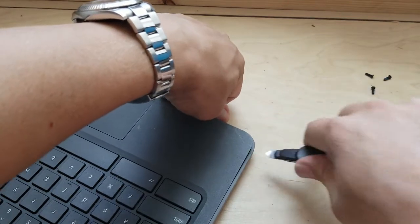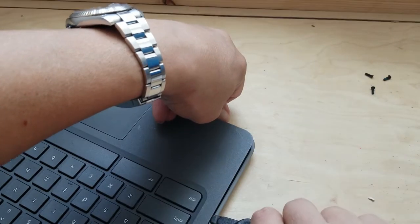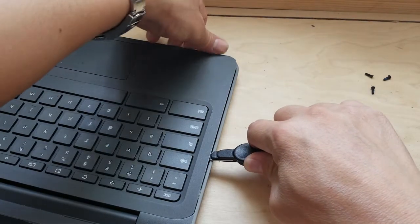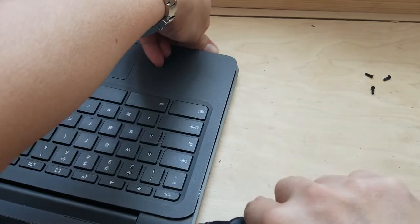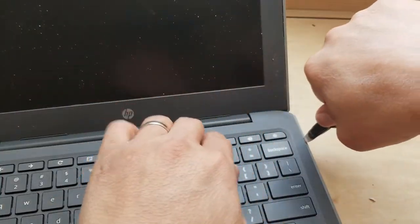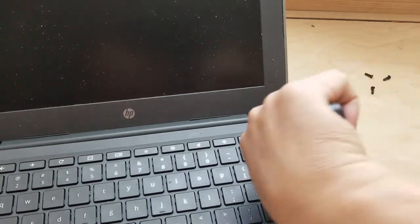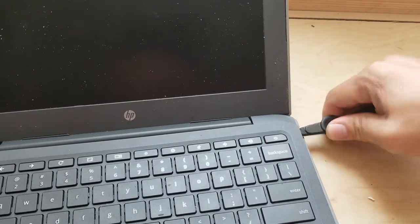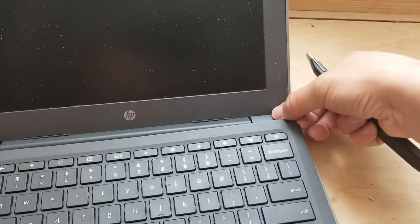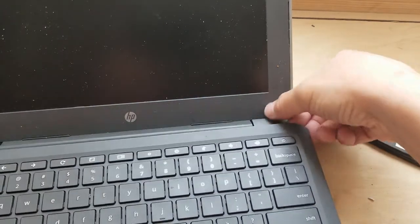Sometimes it can get a little hard, so use your finger to pry open. There's a gap where you can stick the staple remover in and then pop it up. Toward the front, it's kind of clipped from the inside — just pop it up a little bit. Make sure you have unscrewed all the screws, because if you miss one and force it, you'll either damage the keyboard or break the plastic screw mount, and that screw won't be useful anymore.